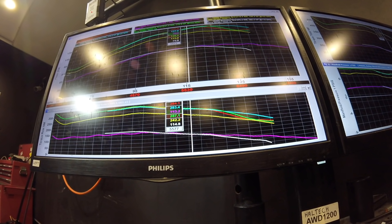129, 130, 131, 129, 131 — that's what's going on. The intercooler is obviously the right size — it doesn't suffer any heat. Even after sitting for five minutes, you can't cool it down any more than the 35-degree inlet it's got. It's picked up 55 kilowatts with eight pounds of boost — pretty good. That's about right — five and a half pounds to make the extra power and about two pounds to drive the supercharger itself, which is sapping energy. So that all seems very fair.